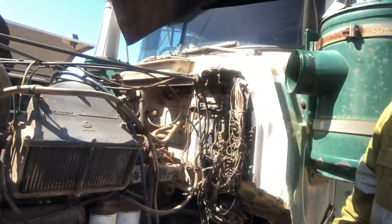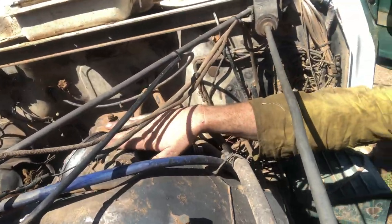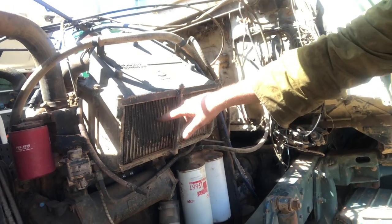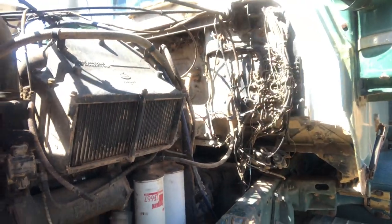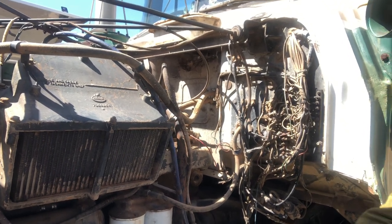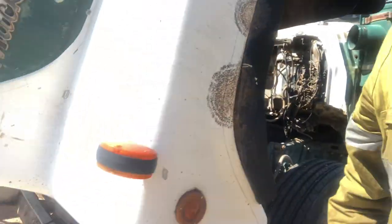So a little bit on that Coolpower box. I just did a little bit of an explanation the other day, but air will come in through that air cleaner. It's drawn in through that tip turbine fan there, through this cooler box, and air just comes straight back out here, which cools air going in on the opposing faces of these fins into the engine. So yeah, not a bad idea, but very complicated, really. You lose a bit of boost because it's got to drive that tip turbine fan. So once they went to the intercooler at the front of them, they're a lot better idea, a lot cleaner, easier to work on, all those sorts of things that the mechanics appreciate. We'll have a look around this other side.